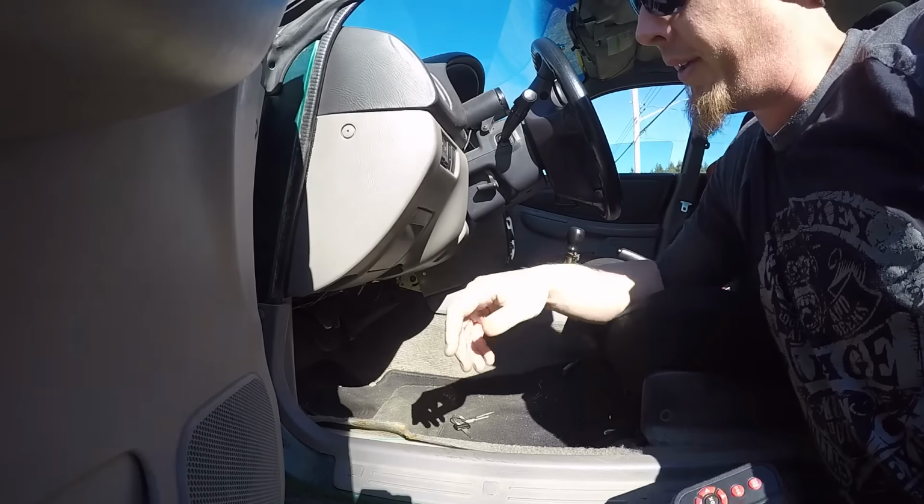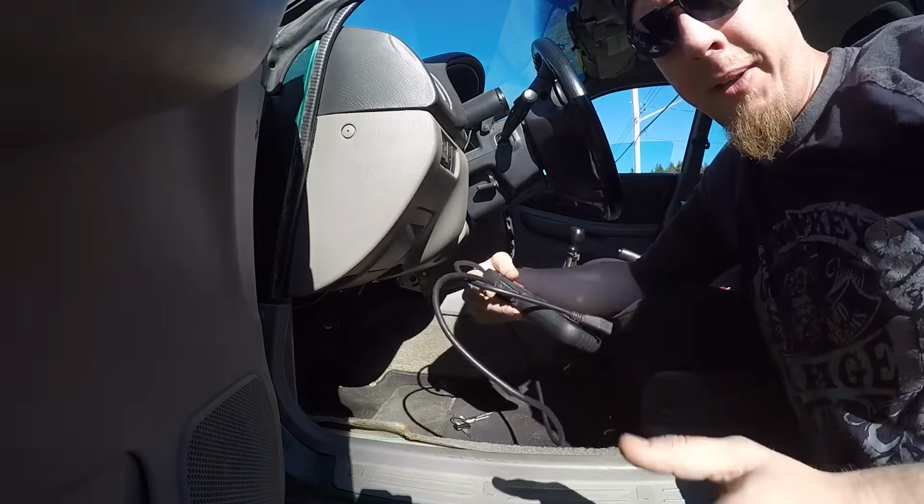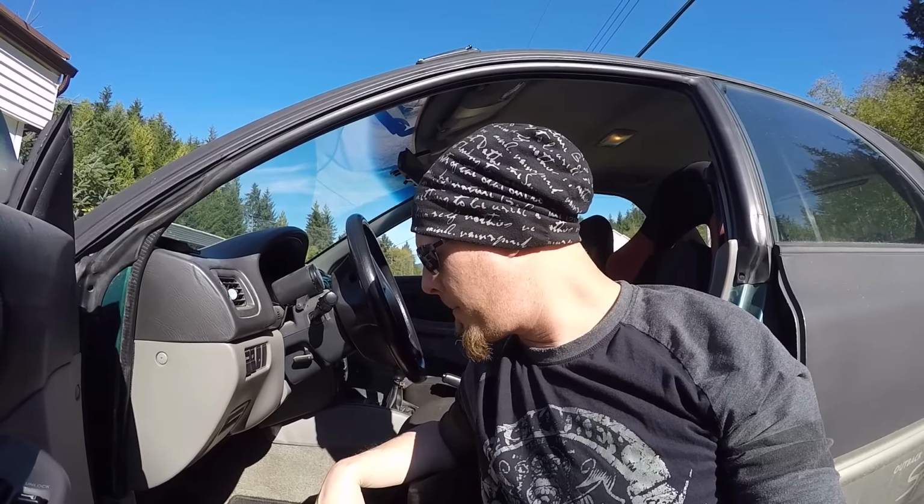I was thinking of pulling the intercooler off and cleaning the throttle body and possibly putting in the spring wire, but I don't have a lot of time left in the day because I'm going out tonight. I was thinking of leaving some stuff till tomorrow, but the weather's not going to be very nice tomorrow. It's supposed to rain pretty hard. So I should probably just pull off the intercooler. That goes pretty quick, and at least check the throttle body and see if it's dirty around the bore, because I had a lot of blow-by and oil come out of the intercooler. It might just be a waste of time, but it only takes me 10 minutes, so I think that's where I'm going next.